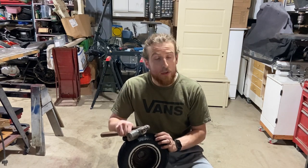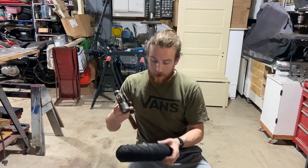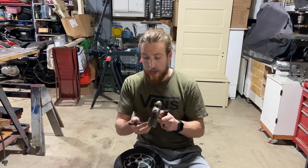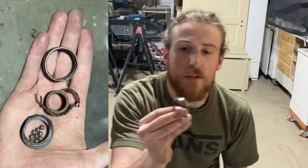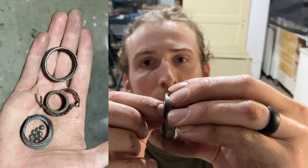It had rusted so bad that I spent a good three hours on it with my new puller set, which was such a help. I ended up using the puller, getting behind there, and after hours and hours of hammering it finally came out. Initially the inner portion of the bearing came out just fine, but the outer portion was fused. You can see there is just corrosion and rust along that edge — it was not budging. But some WD-40, some Kroil, and my puller set and I was able to get it out.